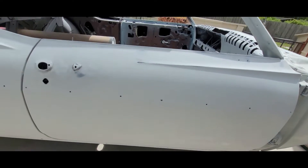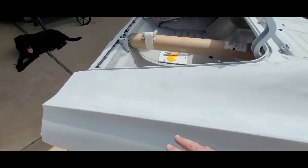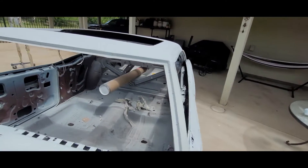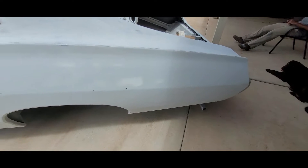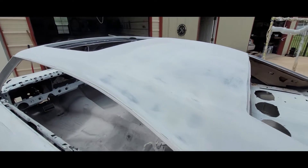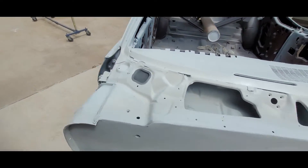You can see where we got a little breakthrough to the epoxy underneath, which is good — means there's not a lot of material. Mainly we wanted it right here where it was really wavy and we got some breakthrough so it's pretty thin. I think I only put one coat of Super Build up here when we did it; I think I put three coats around the roof so that came out nice. On this side we got some breakthrough here to the epoxy, which tells us we don't have a whole lot of material — just where it counts.